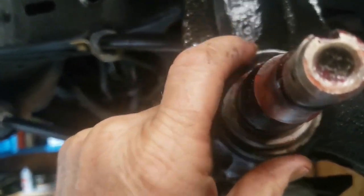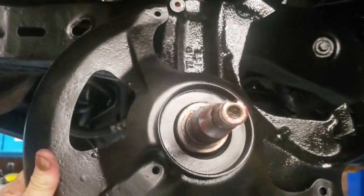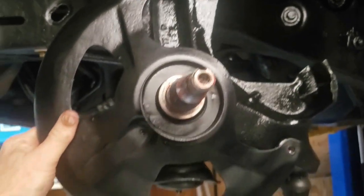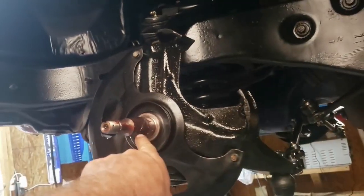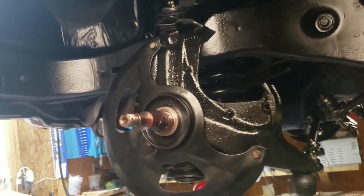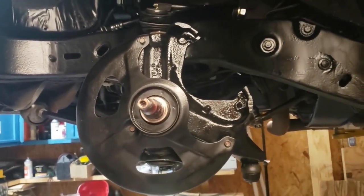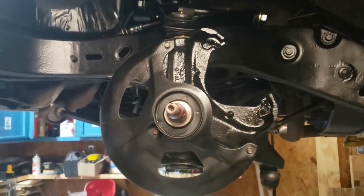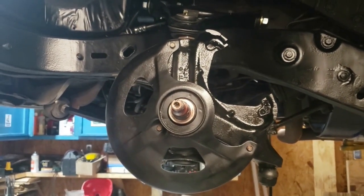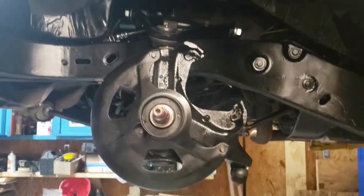This little rubber o-ring came from behind the dust shield — it was pretty nasty but there's nothing wrong with it, so I'm going to reuse it. We're going to take our refurbished dust shields and slip them into place with three bolts. Starting to look like something — got the dust shields on there, cleaned up the spindles, got a fresh coat of grease on there to keep corrosion down. The next thing is to get the rotors back on the car. I did a preliminary check of the driver's side rotor, pulled out the outer bearing and it was fine — I did the bearings about five years ago so I'm not going to worry about them.